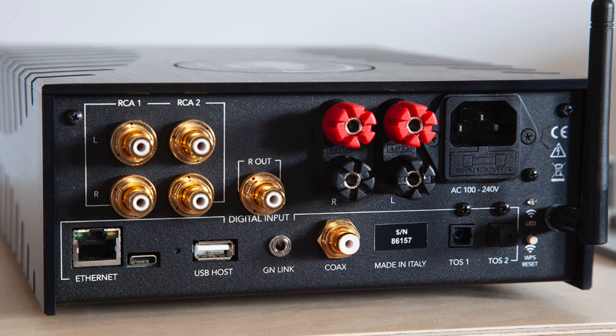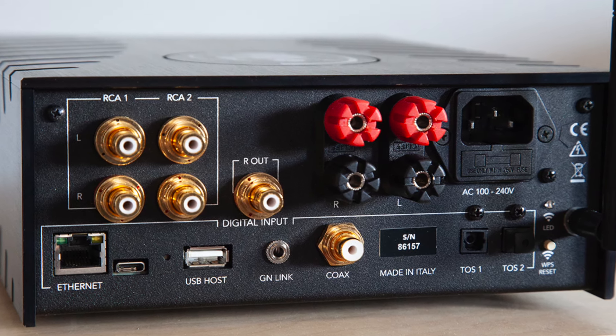Given all this power in a tiny box, is it Class D? It is — it's a Class A preamp stage and then the output stages are Class D. I have to say it's one of the better Class D implementations I've heard; some can be quite coarse, but this is really refined. Gold Note have gone to a lot of trouble looking at both the damping factor and the current, and that's continuously variable depending upon the load you connect — which really seems to make Class D more than acceptable here.